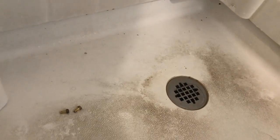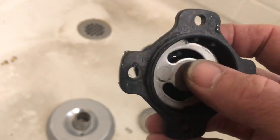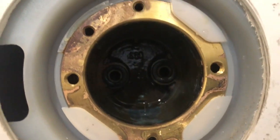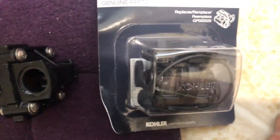The piece that's behind there should come out with this. Here's the new one — see how the new one's all one piece. That's real common on these: when you pull this out, the other piece behind it is going to stick in there — and it did. There it is with the o-ring and stuff. The mixer is right in there, that's got to come out next. So they redesigned this — I gotta get those two o-rings off and make sure I get all the dirt out. That's the old version, this is the new version.